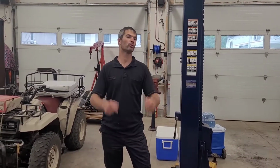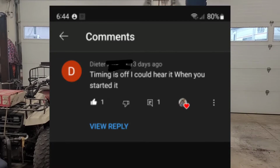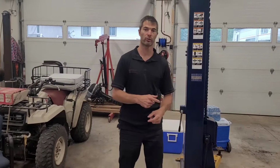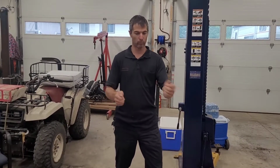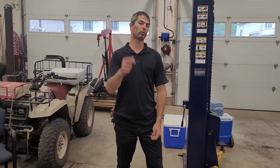And Dieter, thank you so much for your comment because it struck a pretty good train of thought with me, something that I completely forgot to do. Let me take you back about a year's time when I first started working on Suzy, when I picked her up in the bush. Off camera, I actually did the timing just by ear. I didn't do the timing with a light because I didn't have one. I locked everything down, the distributor was fine, and ever since then I've always noticed there was a little bit of a miss, and I've always attributed it to other things and completely forgot that I never did the timing until now. So that's what we're going to do today.